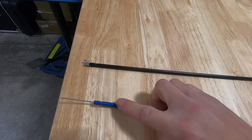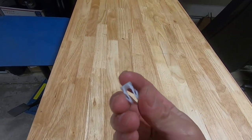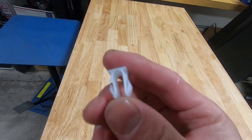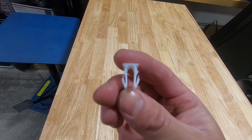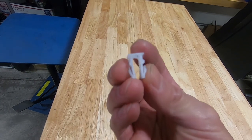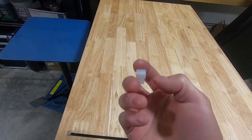I got the notch for the heater line cut. This goes in the back of the climate control and hooks onto where that notch is. These are kind of tricky to take out — the two legs on the side you want to pinch each leg closed, push it up on one side, then the other. I want to make note that the climate control can get brittle, which is why I recommend buying a new one. The part numbers for these are also in the description below.